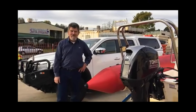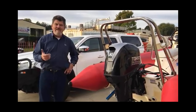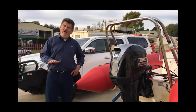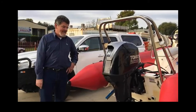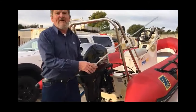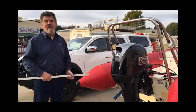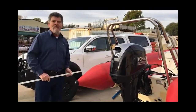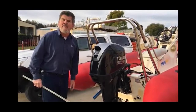Boat owners and fishermen, Wally Stepnick here from the boating scene once again. This week I'd like to cover a problem that's come up from time to time about boats rolling over under hard acceleration. And it's a very simple, very easy cure, which we've sort of covered in one of the videos earlier on. But what it has got to do with is the turning action of the propeller and a motor fitted incorrectly. The reason the boat rolls over is because the engine is too deep on the transom.